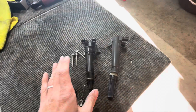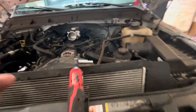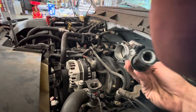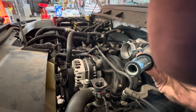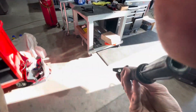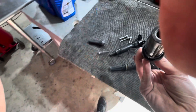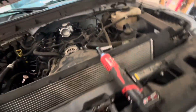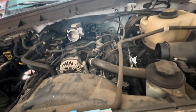Service these things because it's going to cost you a lot of money in the future. It corrodes like crazy. We've seen enough of these — it gets to the point where it'll take out the PCM, the computer. It'll misfire so bad that these things will arc out and we've seen them take out PCMs. Just weird stalling, wrench lights, misfire codes.